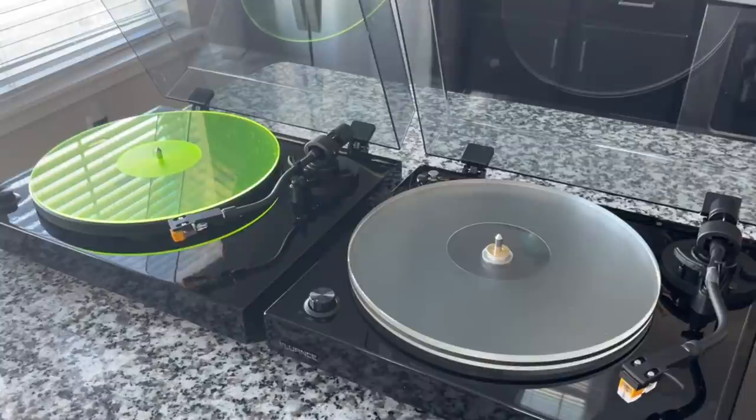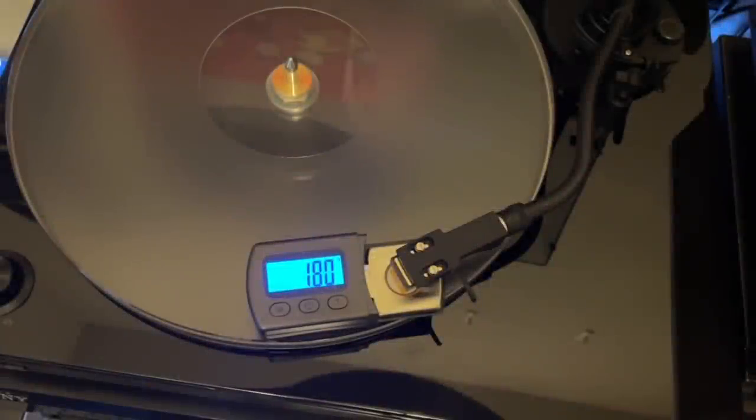I am going to dethrone the LP3 for the time being in my office listening room and connect this paired with a preamp. We are going to give it a good in-the-room listen with my Fluance speakers, and we'll do a direct feed test as well. I have it set to 1.8 grams, which is the most ideal tracking force from my research. This cartridge is pre-aligned at the factory. Everything is connected — it's time to spin up some vinyl.